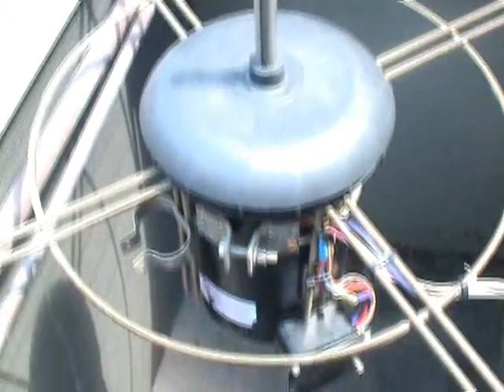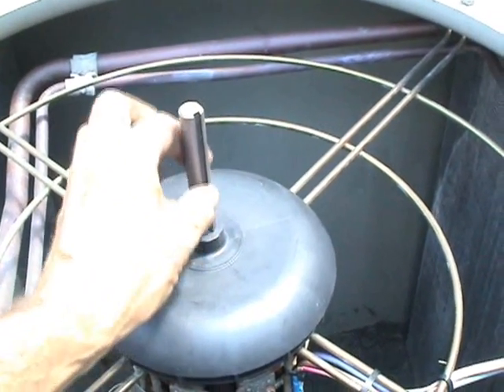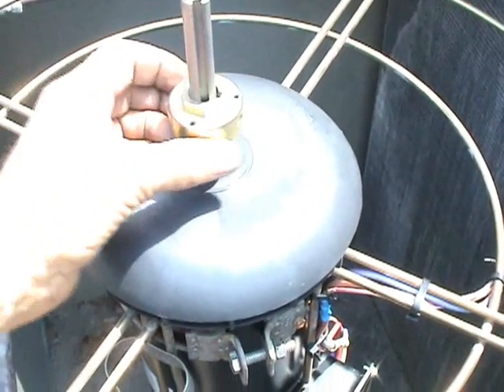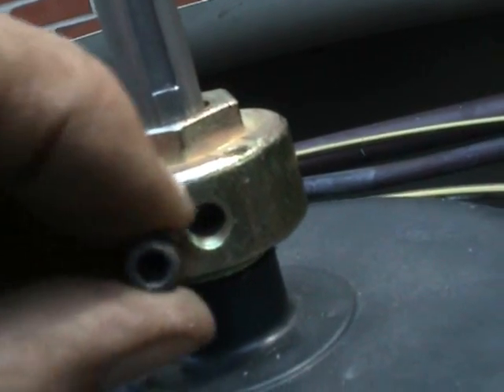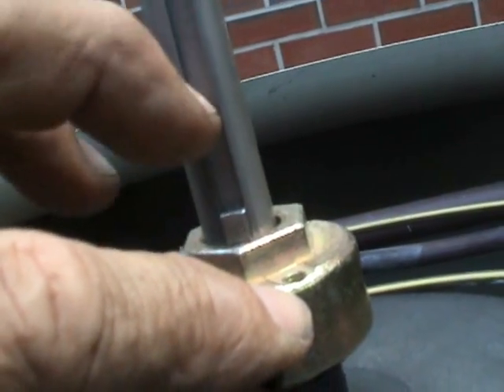Here's what the fan motor looks like from the top side without the blade on. Now it's time to put on the blade. First we'll fit it for the hub — I set the blade on and dry fit the thing. Here's the hub; I know where I need to bolt the hub down and I'll do that first. This type has a key and keyway that you have to set in — slide it down into position, all the way to the bottom.